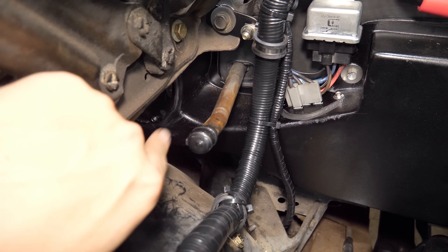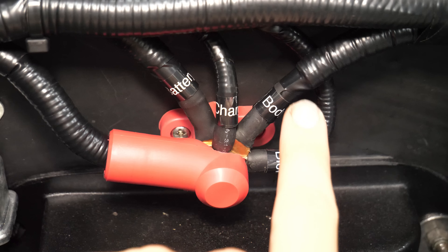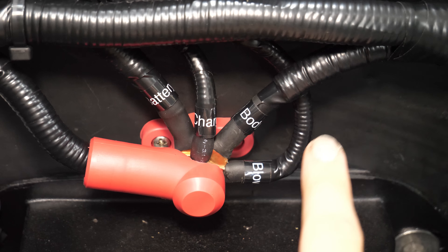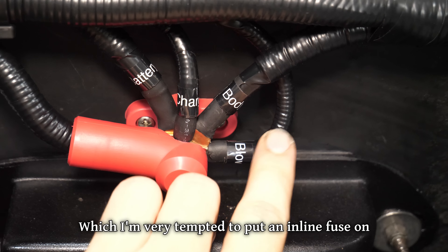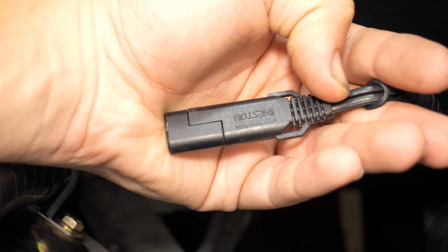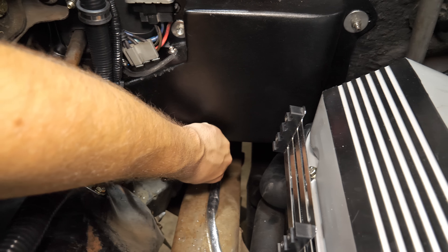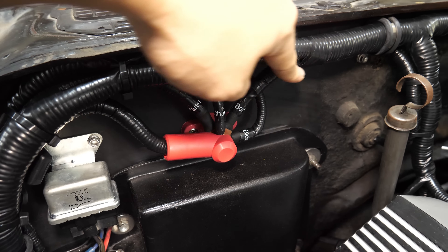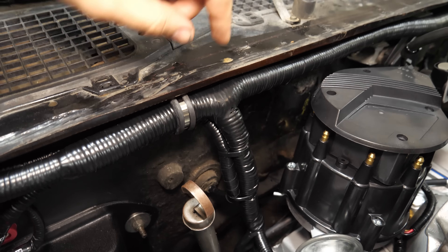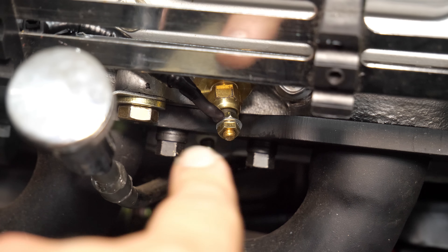This main mount is actually on a bracket that helps get the clamp far enough away from the hood hinge and spring, and there's still plenty of room for the heater hoses. Under this boot is the fuse box feed wire — this is a six gauge. Also hooked up here is a six gauge for the main body feed. That wire is probably a little too big, but it ends up in two 12 gauges. We also have the blower motor feed and a charge connector that uses an inline 10 amp fuse — the idea is for this connector to be accessible when the car is covered. Some of the wires carry straight over past the junction block, hug the top of the firewall, and some split off into a T. One section goes down to the transmission, and one leg comes down along the back of the cylinder head for the coolant temperature sender.